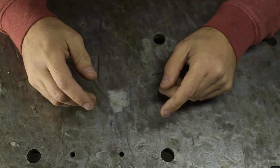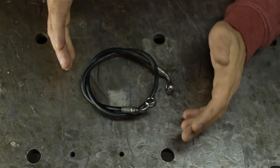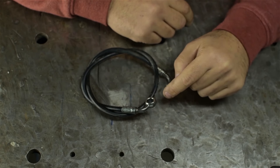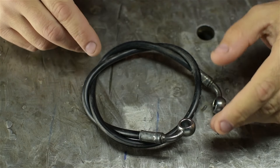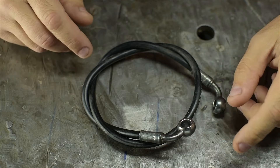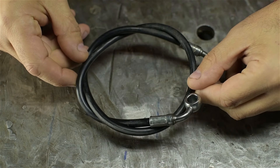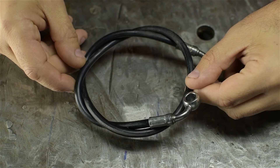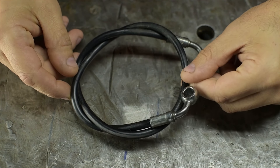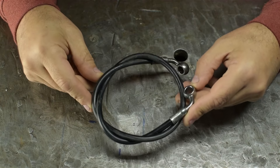This story has gotten to be 15 minutes longer than it should have been, so let's bring it home. Twice a week during marriage counseling, my mind got to wandering, and it settled on the brake line itself. It's not unheard of for brake lines to go bad — and for the third time, I was 100% sure I'd found the problem. A bad line in a car usually results in a locked-up caliper. They can go soft and mushy, or develop a weak spot — when you brake, the pressure inflates them like a balloon, and the brake line itself robs you of stopping power. If you can't tell by the fact that I'm holding a perfectly good brake line and I'm still talking, the problem wasn't this.